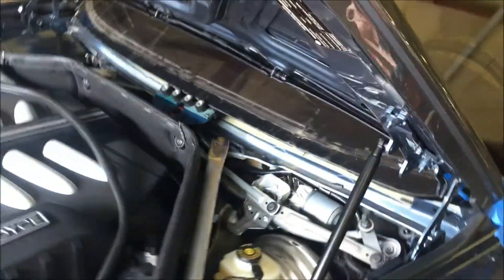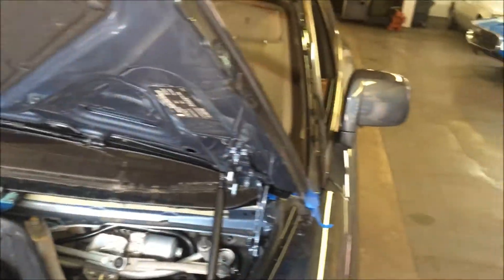One of the main reasons we want to use the Rolodeck, even though we have two guys here today, is because we want to make certain that we get the windshield placed precisely back where the original installation was. There's no guide anywhere other than maybe making measurements to determine where you need to be top to bottom. You can center it left to right easily enough, but you could be off a little bit top to bottom if you don't know exactly where to place it.